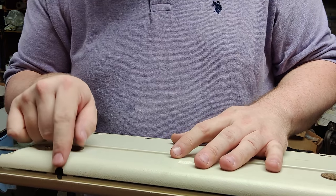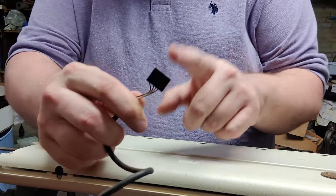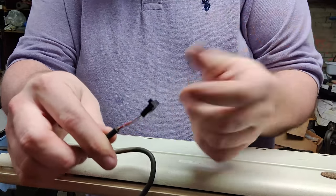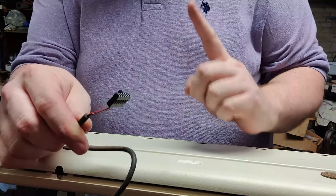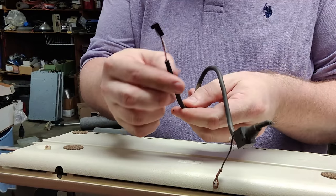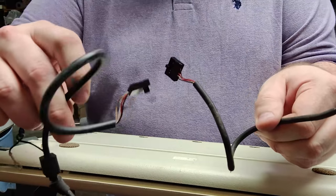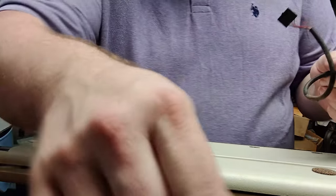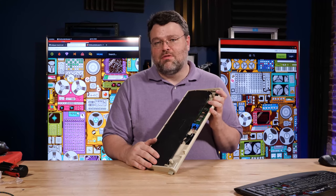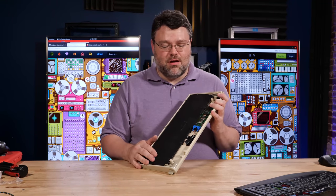The controller is the next part. I had a cable that was damaged — don't worry, this is a reversible mod. You can undo this if you want to go back to the original XT. Those cables' insulation breaks down and they're a little suspect — they can blow fuses. That's true of the Model F as well as the Model M's cable, whether you've got the SDL jack (the removable cable) or the built-in cable. The plastic is really breaking down and can't be counted on to prevent the five volts from shorting out ground.